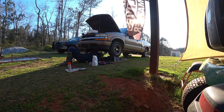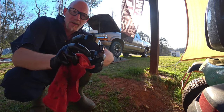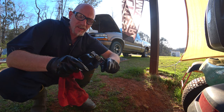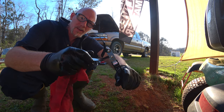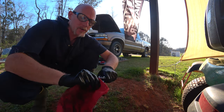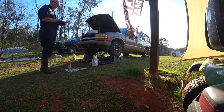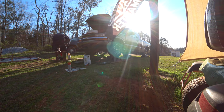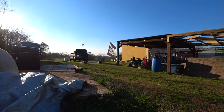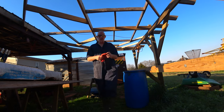That sucked. The way you actually want a filter wrench to work is you want it to be able to circle over as much as possible, because that provides the most tension. This one is so small, that's all I could move it, just like that. So I'm actually going to order a set on Amazon that was like $41 for a 4 set, and then I'll have 6. Probably 2 of the same, but still. It's worth it not to ever run into this trouble again. One more thing, guys.